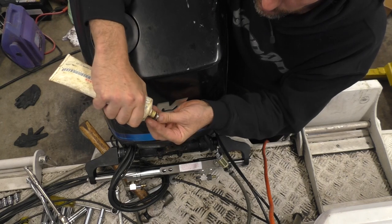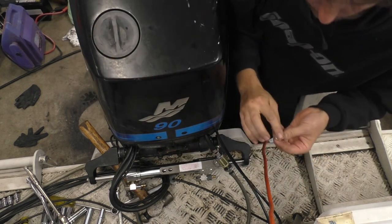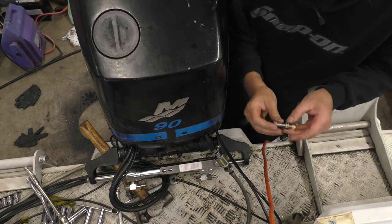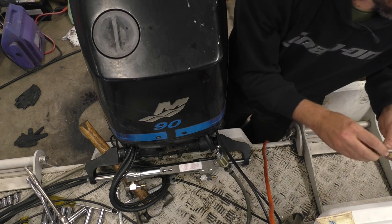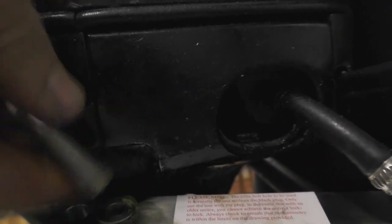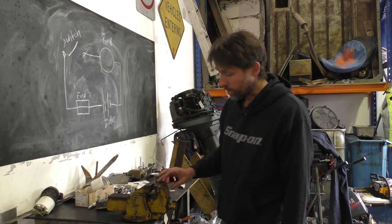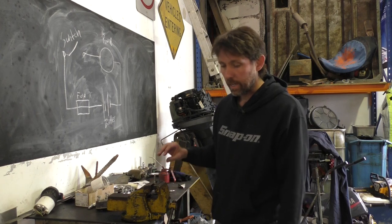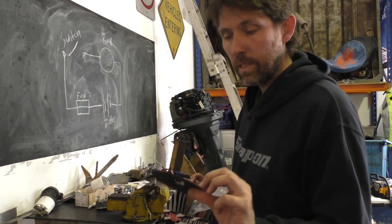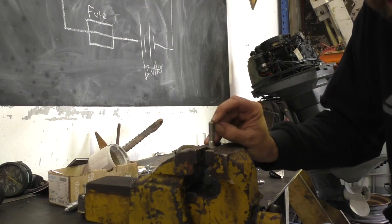The spray grease is good for the steering tube but a bit too thin for these bushings. I need to cut this bolt a bit shorter because I don't have enough clearance. I've got the head firmly clamped in the vice and I'm going to use a thin blade angle grinder — these blades are 0.8 of a millimetre thick, so pretty fine. I'm looking to take about 10 millimetres off, and I've already checked there's plenty of thread left to get the nut on the end.